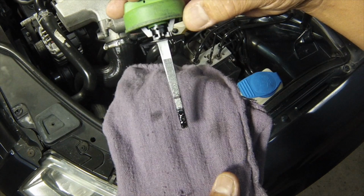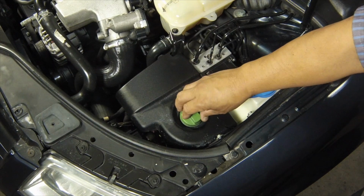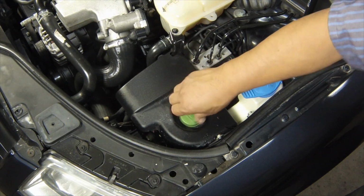If the fluid is cold, that is less than 50 degrees centigrade, the level must be within 2 mm above or below the min marking. If it is hot, the level must be between the min and max marks. When topping up is required, add the specified type of fluid as necessary. On completion, refit and tighten the cap.